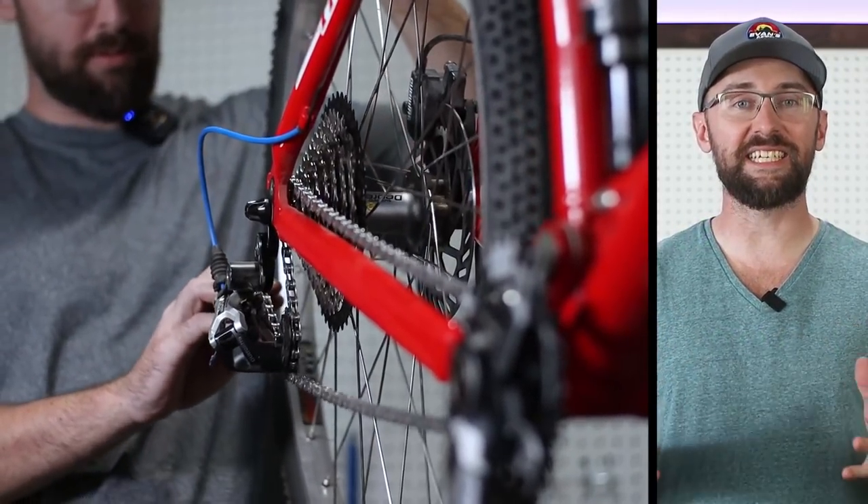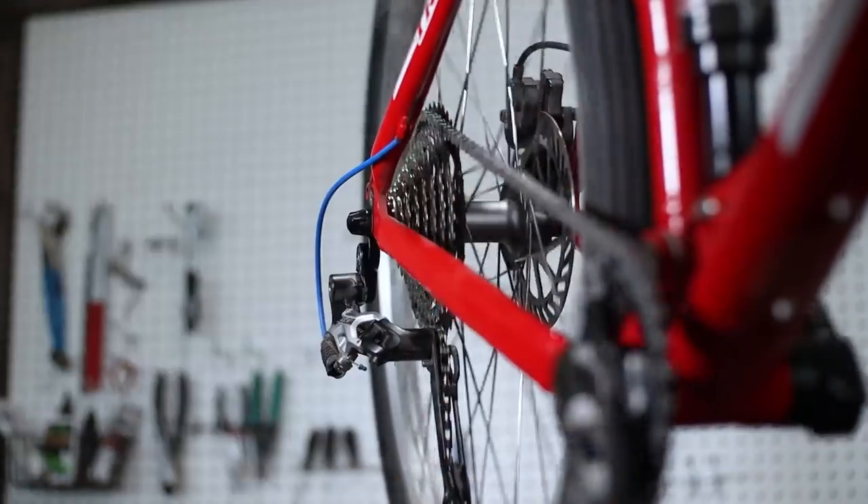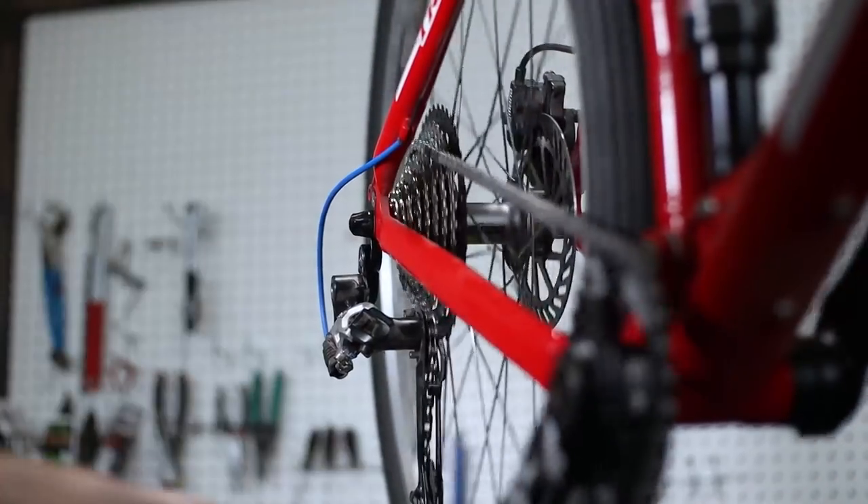For reference, my Mythique's rear cassette goes to 50 teeth and the gear inches for that is 18.24. So even though that's an eight teeth difference, the wheel size changes everything. Just need some adjustments, but I think this works. It's a miracle.